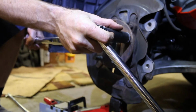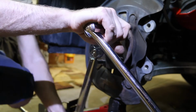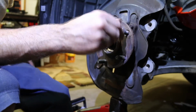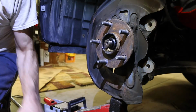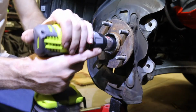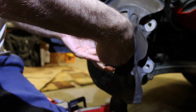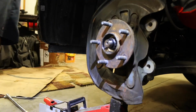Okay guys, we got a little contraption rigged up here. We're trying to torque down the axle spindle nut. I don't want to bend these things. And we're having trouble because it needs to be torqued to 217 foot-pounds, but we're nervous about putting that much pressure on these delicate components. And add insult to injury, our torque wrench only goes to 150 foot-pounds. I mean, I'll just have to. It's tight.